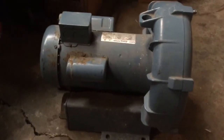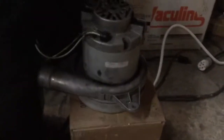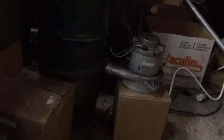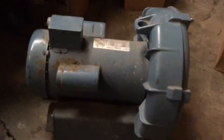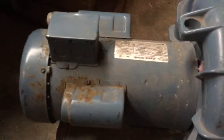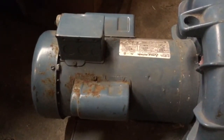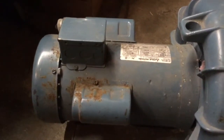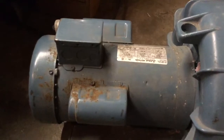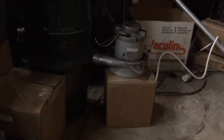In a regular home central vacuum, the motors spin so fast that they can be really small and have just one, two, or sometimes three impeller stages and produce terrific performance. But since they have brushes, they usually don't last longer than 500 to 1,000 hours. In a home that gives you 20-plus years, but in commercial applications where the thing is running all the time, you need something more durable. The induction motor suits that need — there are no brushes, it's just limited by the life of the bearings and not letting the windings overheat. Generally these can run for tens of thousands of hours with ease, but they're limited to either 1,800 or 3,600 RPM instead of 15,000 to 25,000 like the brush motors.